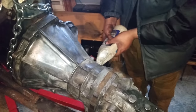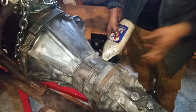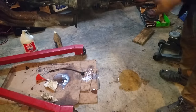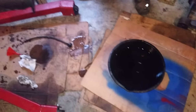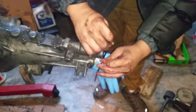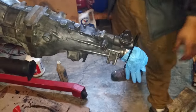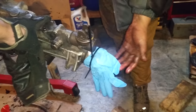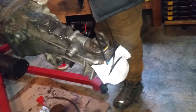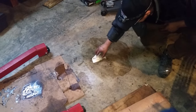It was 100% empty. If he drove this thing on that transmission, it might be time to replace it. As I'm filling it, I don't realize it's actually starting to spill out of the back of the transmission. I rig up a little contraption because I don't have a transmission cap — some paper towels and a rubber glove do just fine. Lesson learned: keep an eye on the back of the transmission when you're filling it up.